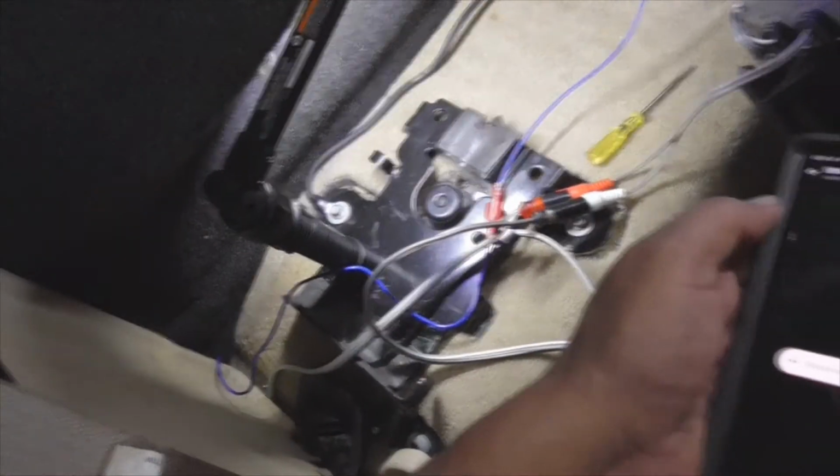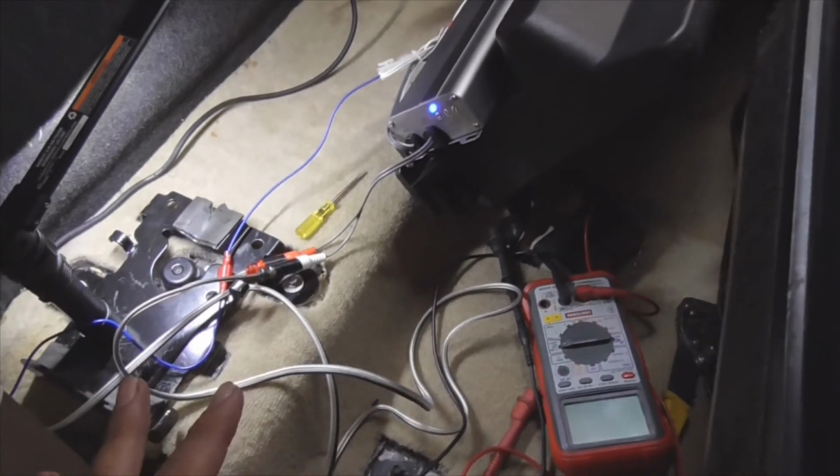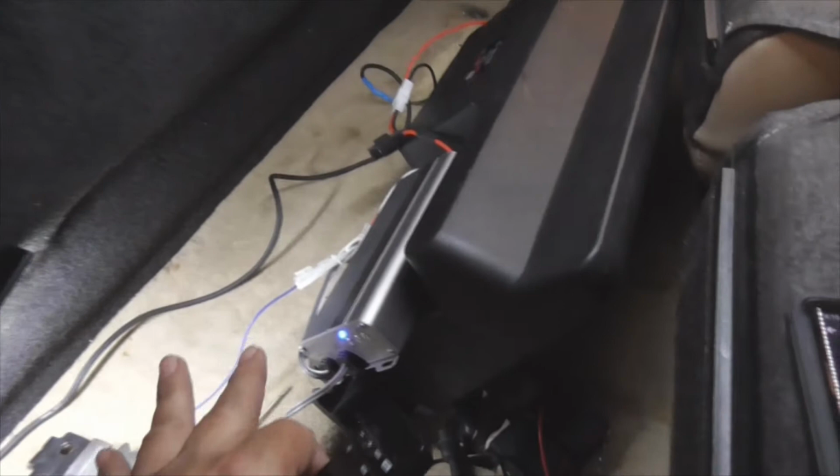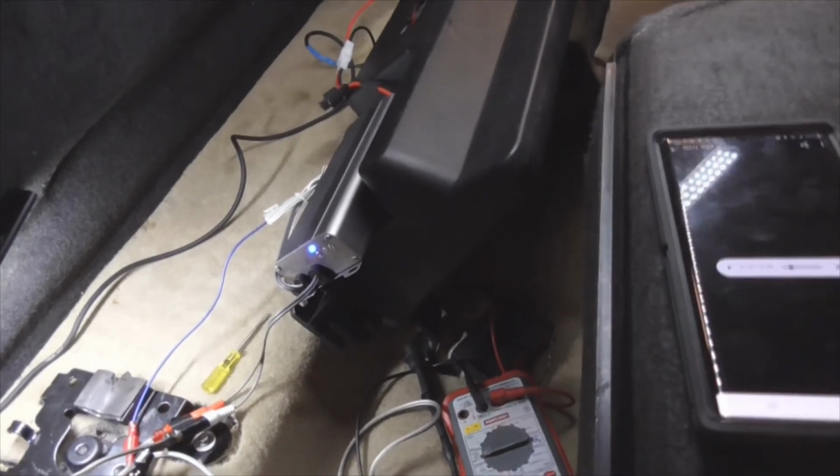And you heard it cut out there. That's because I've got it set at high pass actually on the rear speakers and on the front speakers. So I'm cutting out everything below 160 hertz. Okay, so that's what we're going to do, and let's see if we can get it done. I hope I'll be able to show you it all.